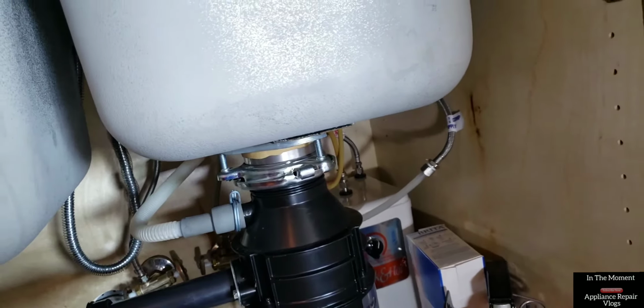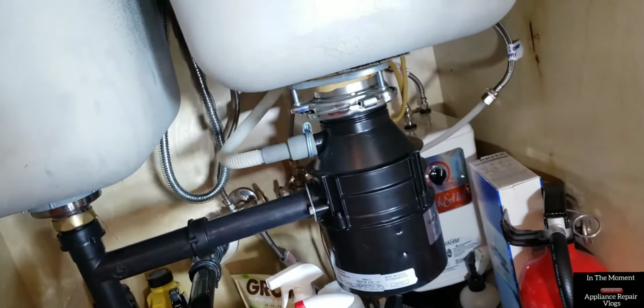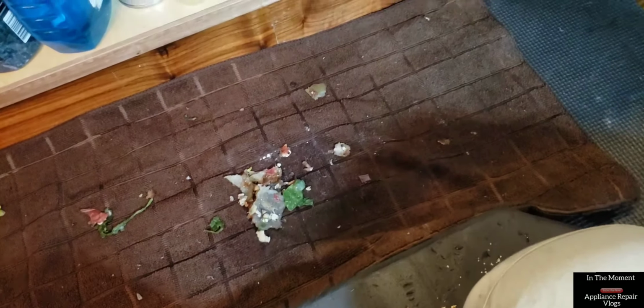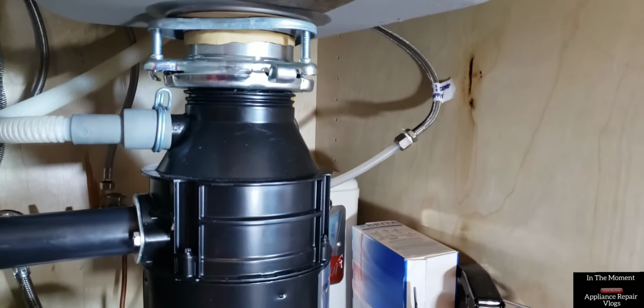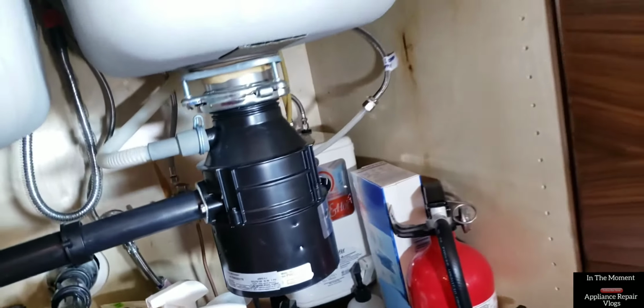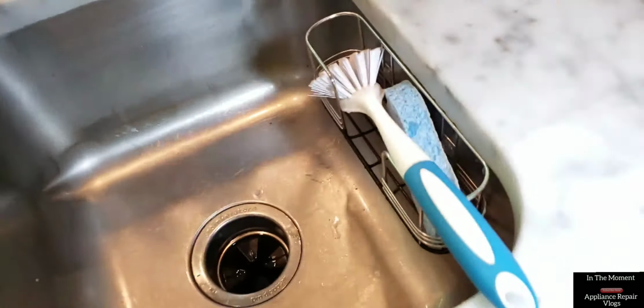Conclusion of repair. Garbage disposal complaint: non-operative. Checked electrical. Electrical checked good. Found objects in garbage disposal preventing chopper blades from swinging onto the cutters. Those were lodged between the blade and the cutters. Removed objects. Uninstall garbage disposal. Reinstall garbage disposal. Check for water leakage and water breach, all checks good. Garbage disposal checks good. Drains good.